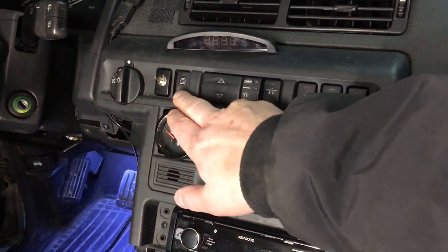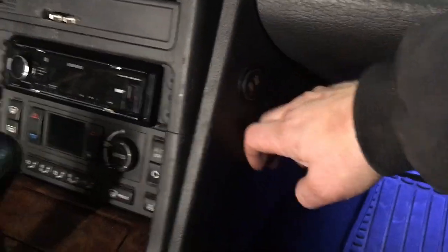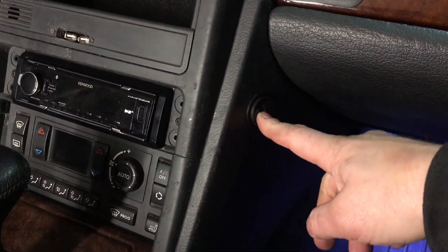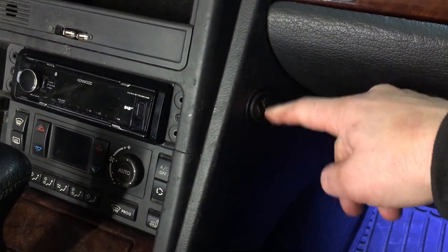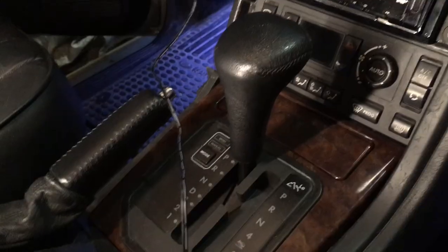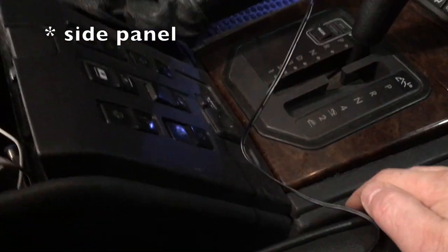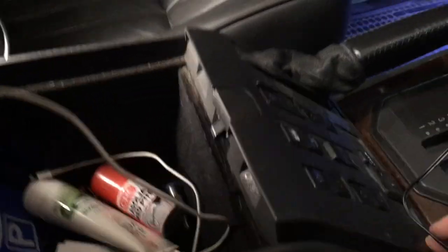But this makes it easier. To remove this trim you have to take off the side panels, which is a pain due to my USB connector. I messed up mounting this, so I'll spend some time removing this trim again and fix that problem once I have it out. To remove this trim you need some space, so you have to loosen this switch panel, and then when you open the center console there's one screw here.